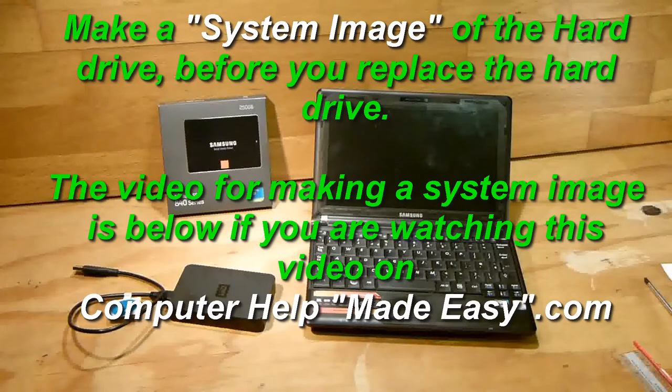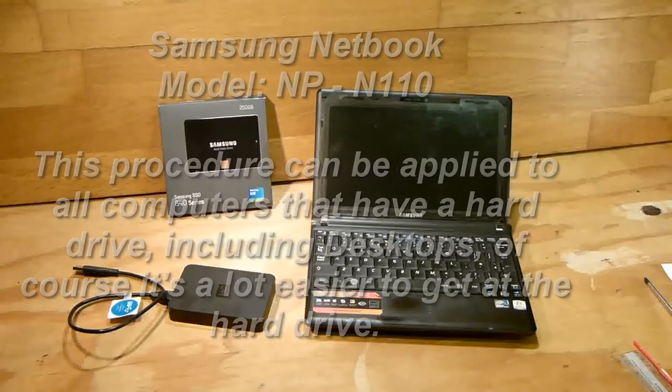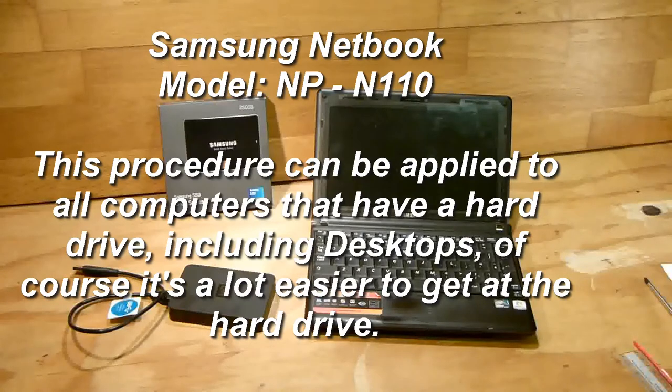So in your Windows 8, 7, or Vista, there is a tool or utility installed which will make a systems image, and there is a video link below this video to show you how to do that, and it's pretty easy. So once you've made your systems image, you will then be ready to replace the hard drive, and in this video I will show you how to replace a netbook hard drive. The model I am using for this demo is a Samsung NP-N110, which is fairly similar to the NC10.